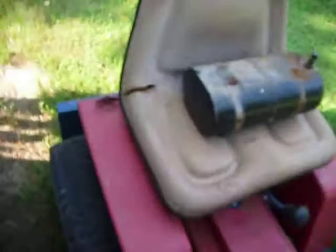It had good oil in it when I got it. The gas tank's off it right now because it's got some crud down in there that needs to be cleaned out badly. I'm just going to take some pea gravel and shake it up in there.